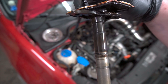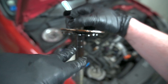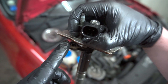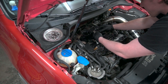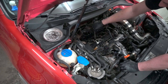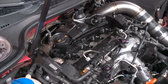All my injectors are already pre-balanced. One very important thing I forgot to mention when putting the injector back in: this metal plate — see how it bows down? If you flip it upside down you can still put it on the injector, but that's not the way it's supposed to be. It's supposed to bow down when you reinstall it — like a U, not an M, if that makes sense. Also, the torque spec for the injector hold-down bolts is about 8 foot-pounds. Make sure you don't drop those bolts — they're super important. All injectors are in, torqued down.